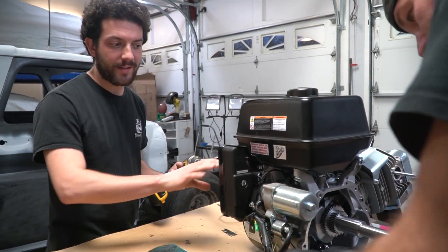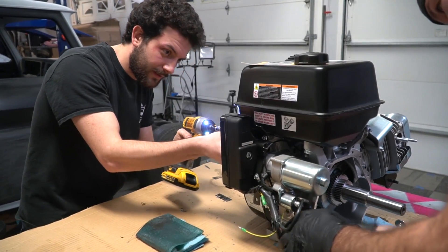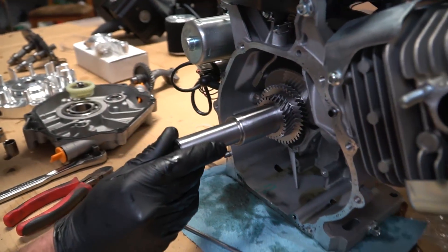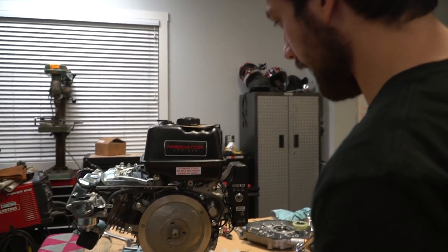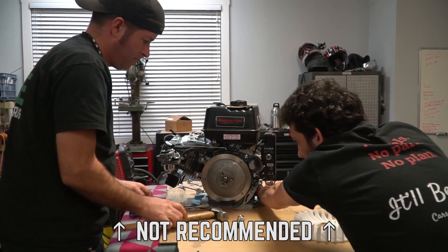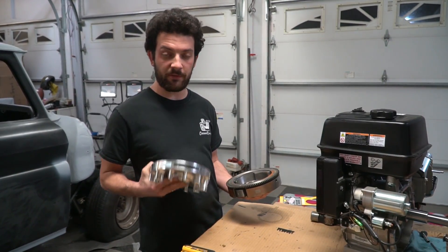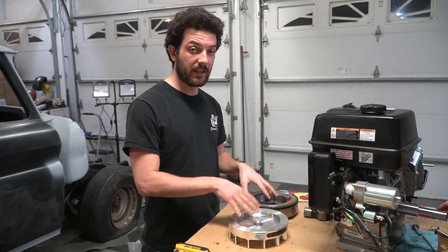While Ike's removing the low oil cutoff sensor, I'm going to go ahead and take the front engine cover off so we can get to the flywheel — probably six 10 millimeter bolts. There's the front cover. The nut to get the flywheel and the fan off. And there's the factory flywheel — it's cast iron. We have the factory cast iron flywheel on the left and the aftermarket billet aluminum flywheel on the right. There's a huge difference in weight — way more than between a 212 factory and billet flywheel. This is going to free up some horsepower for us.